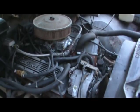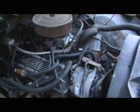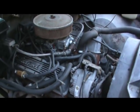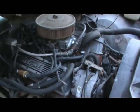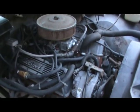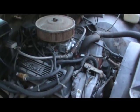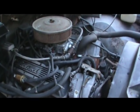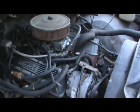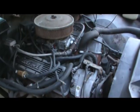There's a 350 I built about five years ago sitting around. I kind of gave the van to dad. I wanted to build a 383 — take his crank, harmonic balancer, and flywheel and with very little machine work stick that crank in a 350, and then you don't have the problems with blowing head gaskets. But I might do that later. This is kind of what dad wants to do — he wanted me to put those heads on here for him.